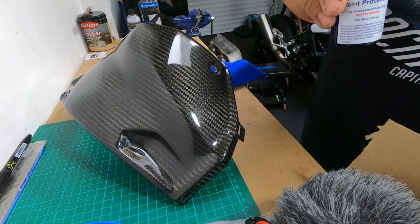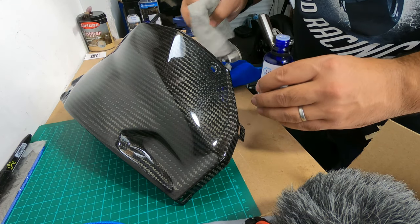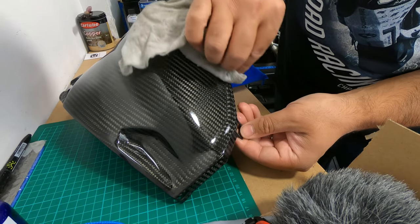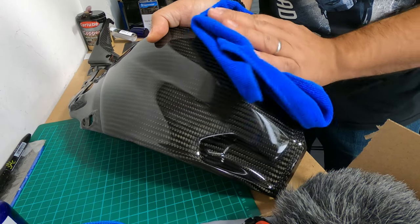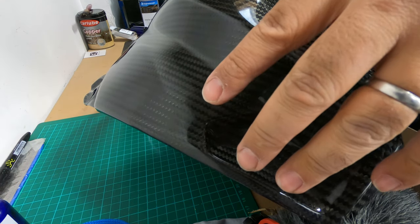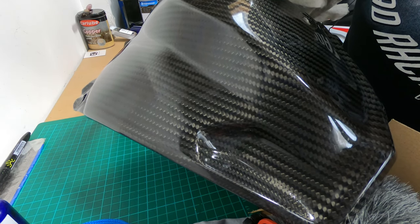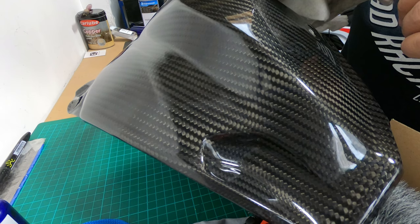It's also UV protectant and it will really bring out the depth of colour in any of the paintwork or the carbon fibre. So I'm going to go ahead and just apply a bit on here. As you can see it's already quite shiny. I've given it a quick degrease so hopefully we're back to the top coat and nothing else on top. I can just about see it going on — you can see it's got wet. The next step is just to give it a quick buff. You can see there's a straight line all the way down the carbon fibre — we've treated this section but this section isn't treated. You can see it just brings out a deeper, much glossier shine to the carbon fibre, gives it much more depth of colour. It also protects it — UV protective, scratch protectant, and it'll make it a lot easier to keep clean. Just wipe it down and it's clean, nothing's going to stick to it.